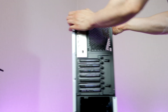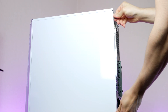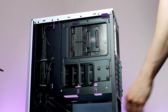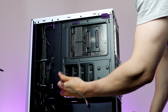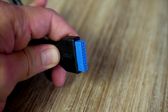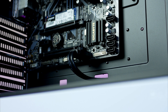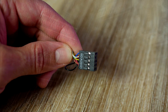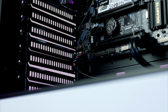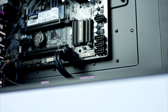Now we're almost ready to install the power supply, but before we do that, let's install the case cables for the power button and the other front IO so we don't have to worry about that later. Starting with USB 3 — the connector is located at the bottom of the motherboard. Moving on to the front audio, that cable goes to the left side corner. Lastly, the front panel connector is on the lower right side of the board.